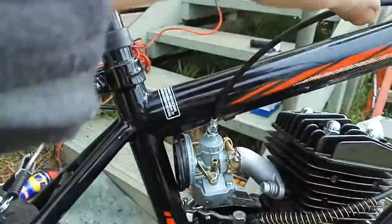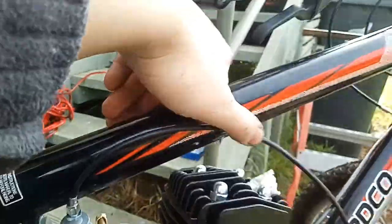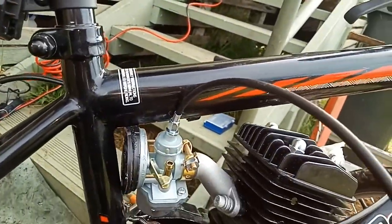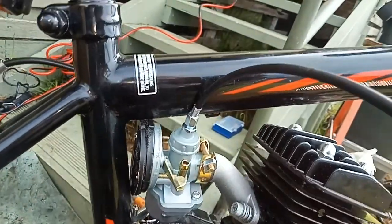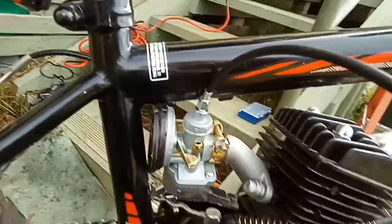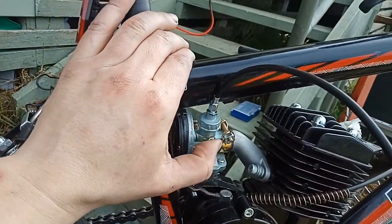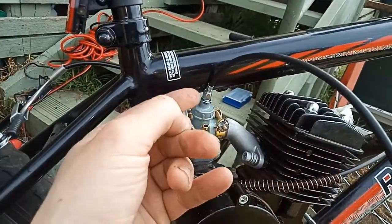The issue you start to see here is this cable gets a bit of a bend in it. I'll probably be able to thread it up under the tank there, but it's always annoyed me that I can't have the carby dead straight because of that cable. The first time I put an engine on this frame with the Mark 1, I actually had the cable sticking up on the other side, and that created a second problem — I didn't have enough room to raise the choke because it would impact on the bar.